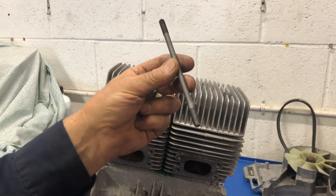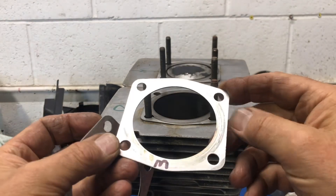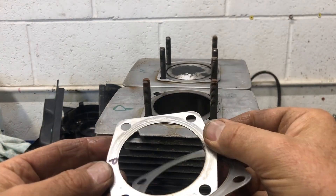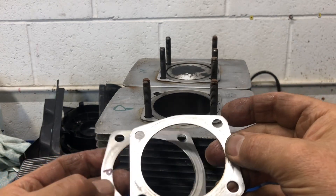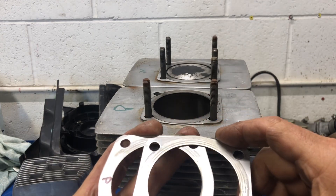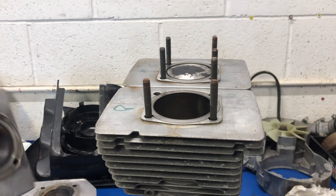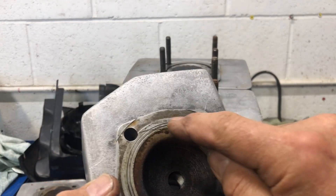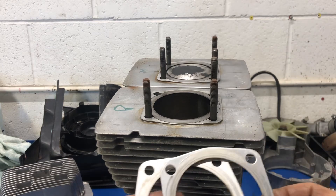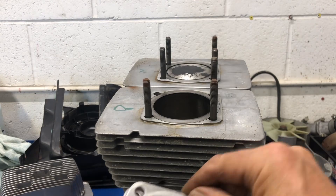At least it's not all rotting out. Head gasket-wise, it doesn't look like — well, they may have not been tightened down all the way, or maybe it didn't have enough running on it since it's been done. It's pretty clean inside actually. This one is starting to form some grooves in it that match these sealing grooves in the cylinder head, and the other one — not so much. So maybe it was tightened unevenly. Not sure, but we'll carry on.